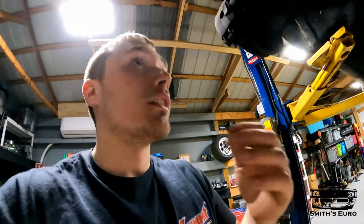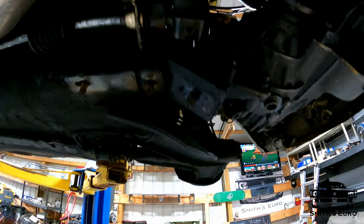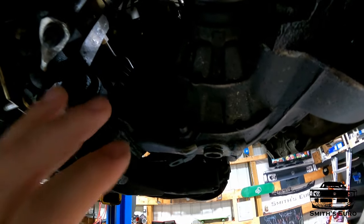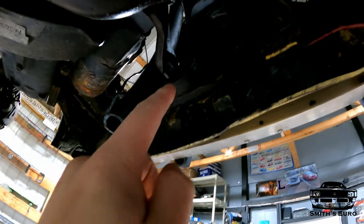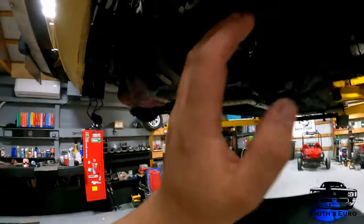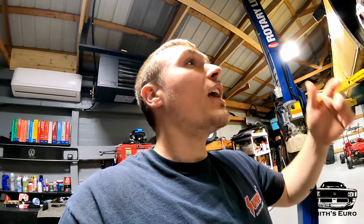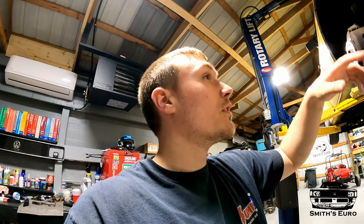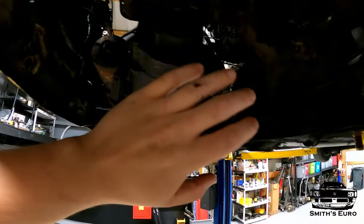I've gotten all the engine mounts loose down here. I've taken this trans-mount bracket off — it just unbolts. I'm going to leave on this transmission everything including the shift linkage since I plan to sell it. Taking the bolts out of the front mount — it's really dark down here, but once all that's loose the only thing left is to disconnect the exhaust, unbolt the nuts, bring the whole exhaust down, and drain the coolant. I've already drained the oil out of both the trans and the engine.